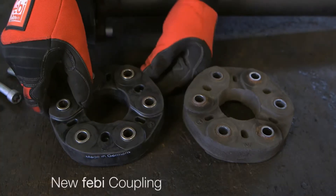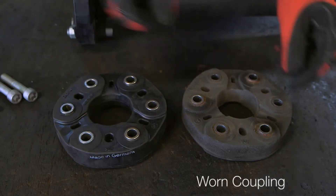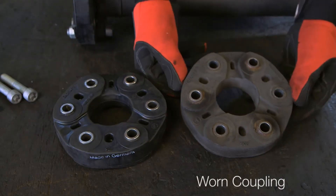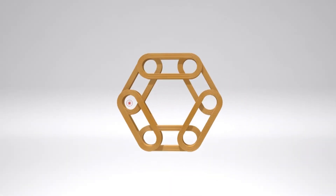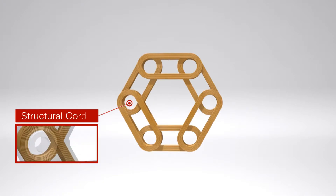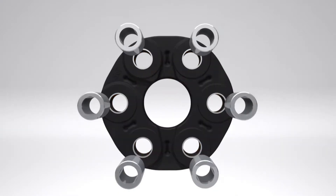A Febi flexible coupling is constructed to absorb impact and shock forces, to reduce drivetrain disturbances and prevent angular misalignment. The torque from the drivetrain is transmitted through specially designed loop packages, made from special textile fibres using unique Tenpu technology, which are then embedded in vulcanised rubber with metal inserts for the retaining bolts.